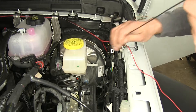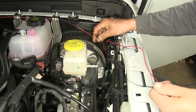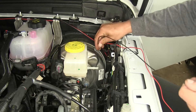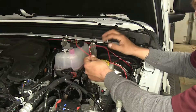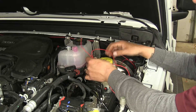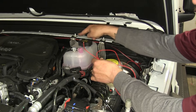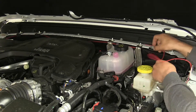You want to be careful not to pull too tight, and it's not a bad idea to go inside and double check that the wires didn't get hung up on anything. We're going to start with our red wire — this is going to be the one supplying power to our switch, so we're just going to route it along the same way towards the passenger side where our battery and fuse holders are in place.